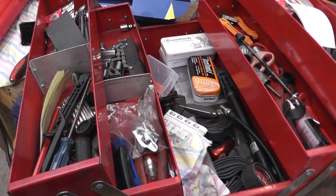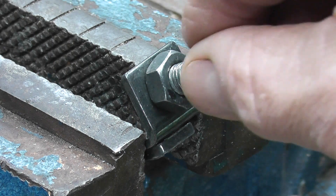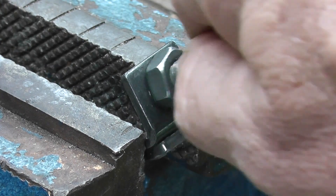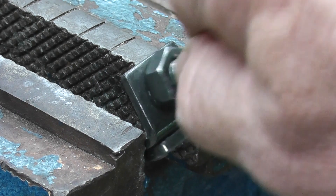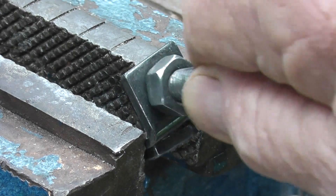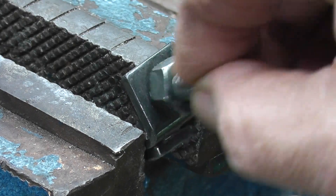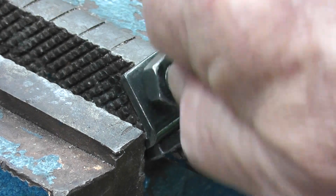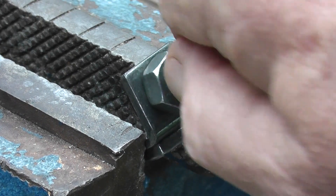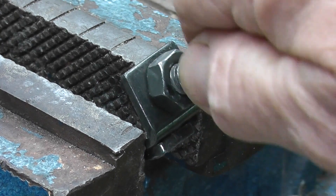Precession — P-R-E-C-E-S-S-I-O-N. Here's a basic demonstration of mechanical precession. I'm going to wiggle this in a clockwise direction and you watch that nut — because it's right-hand thread, you watch it come undone; it's going in an anti-clockwise direction. So if this is on the other side of the machine and now my finger's going in an anti-clockwise direction, that nut's tightening up. It'll get to the point where it'll be quite tight and it'll only continue to get tighter. There we go, that's quite tight now.